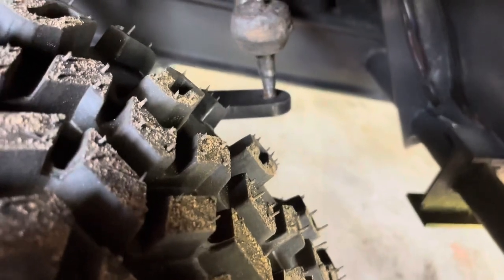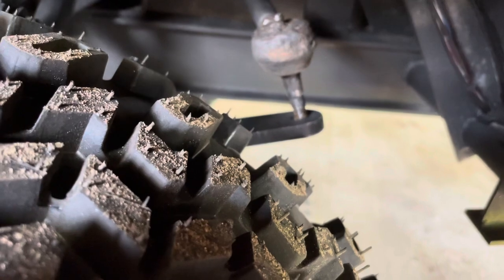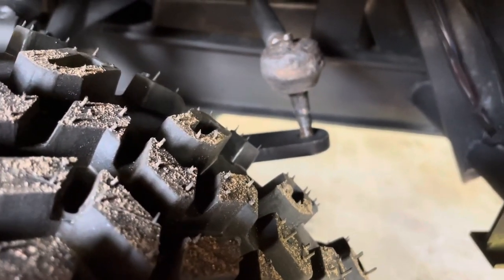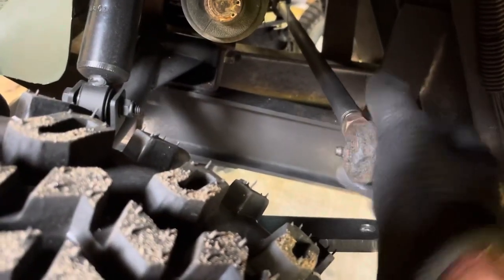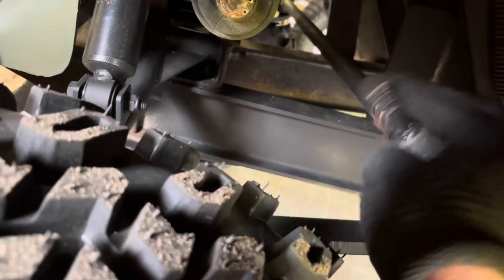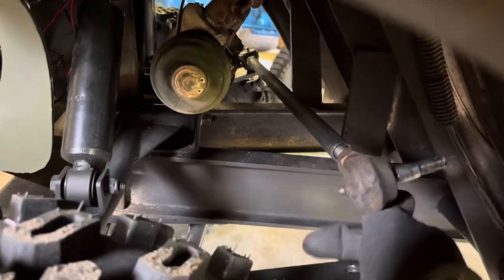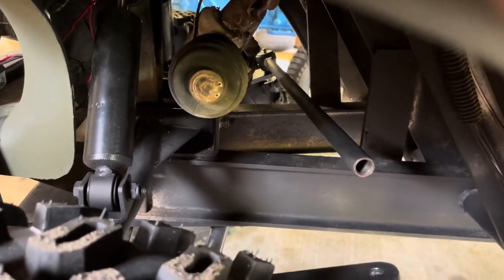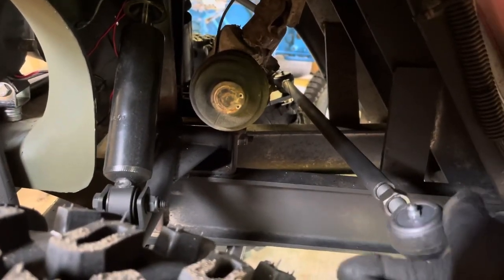You use your breaker bar or your tie rod bar — I don't know the exact name — and just pop it on and pull this one out. I've already manipulated this one so it came out really easy, but whenever you pull the original suspension off you have to give it a good bit of encouragement. Now this is either counter thread or a standard thread. This one is actually a standard thread — lefty loosey — I'm gonna pull it off and my new one is going on, so it should just screw in.